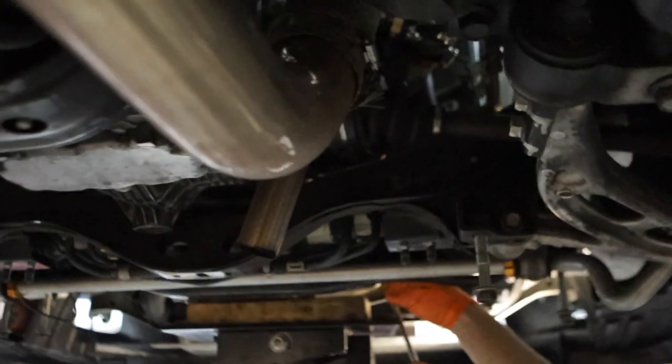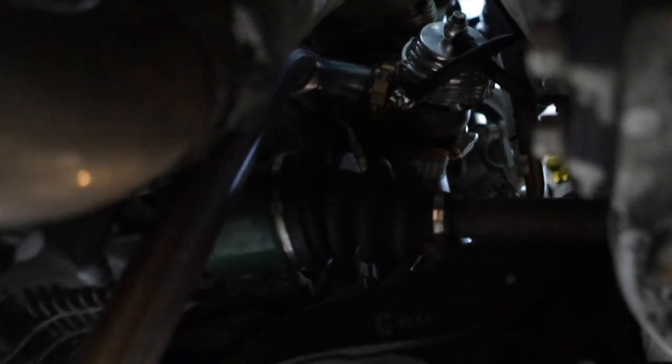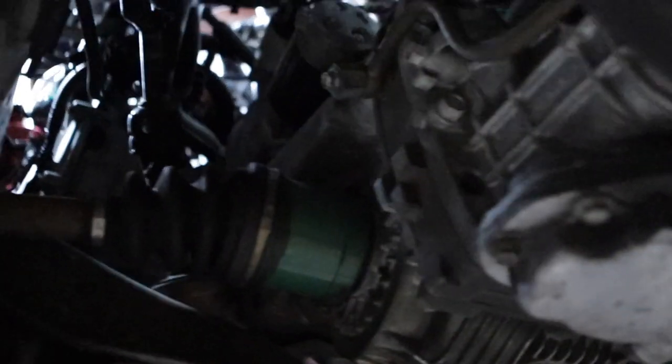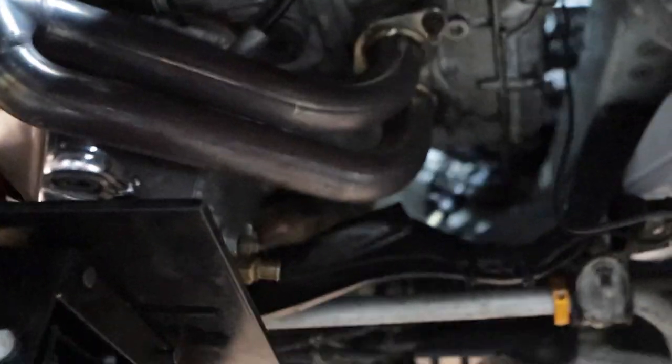We got the transmission cross brace off, and we're about ready to throw the Beat Rush mount onto the cross brace — might have to undo some bolts but we're moving along. It feels weird not working on your own car, but it's in good hands. We're waiting on a 14mm ratcheting swivel-head wrench to get to the rear bolt on the motor mounts. After a rigorous game of Tetris won by Drew, we got the motor mount out without dropping the header. Now the passenger side is player two.